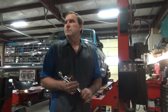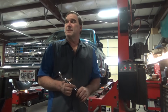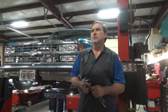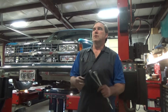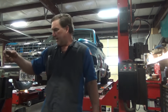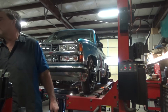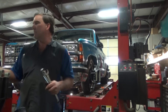I'll go ahead and torque down those U-bolts. I'm happy with the position there. I'm happy with the ride height. Still thinking about changing out the shackles in the back, because that will give us a little bit more pinion angle reduction, but probably only like a degree, which would get us down to 6. So a 3-degree wedge shim in the back would get our pinion angle right where we want it to be. I think I have any this width here. I'll have to think about where I stowed those away. Yeah, that's only a 2-degree, 2-inch, so that won't work.